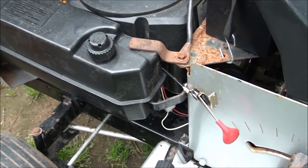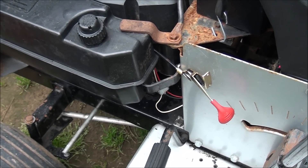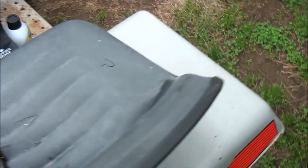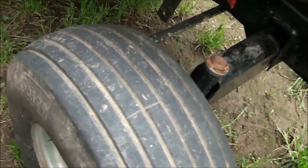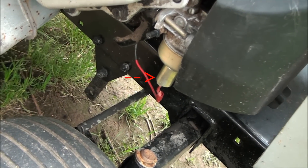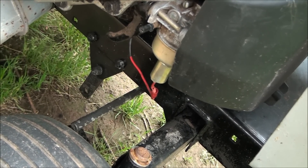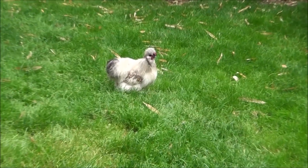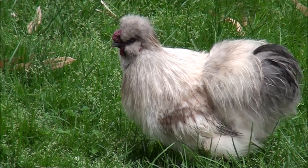Since I don't have lights, I ran the wire that goes to the lighting system over to the fuel solenoid. This particular engine has a fuel solenoid, which is that little electrical component on the bottom of the carburetor. When you turn on the ignition switch it provides power to that fuel solenoid.